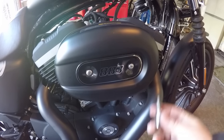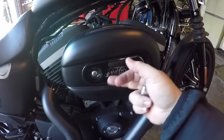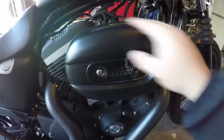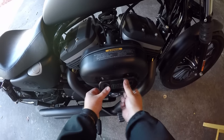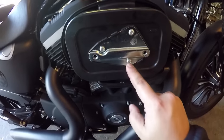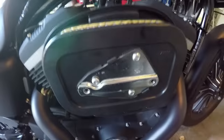To get started taking this one off, you're going to use either an allen key or a hex bit socket. You're going to take these two bolts out, which is going to draw off this little front face plate and loosen this top part so you'll be able to pull it out. After that, you've got these torx bolts — you're going to need a T25 torx bit. Go ahead and take those out.